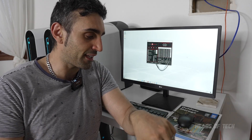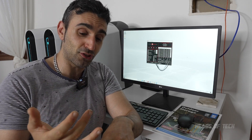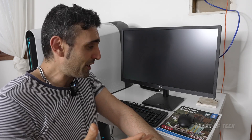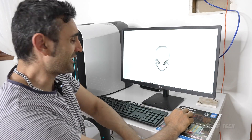I also have a firewall running on my NAS - pfSense, which is open source. That firewall is cool because not only can you choose which IP connections to allow internet access to, you can also throttle the speeds. I limit these computers to as low as 100 kilobytes per second, so if these mining applications are doing something dodgy it limits the amount of bandwidth they can use online.